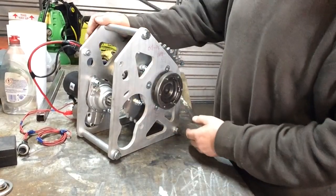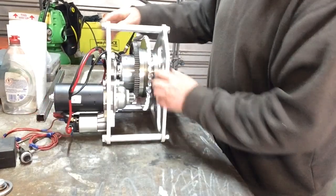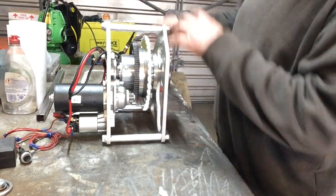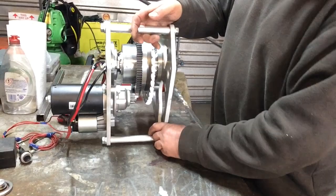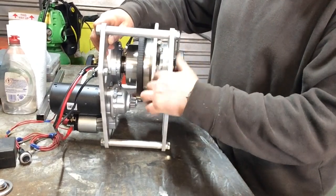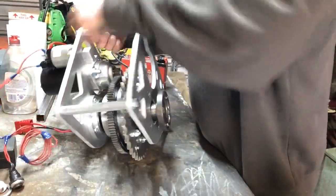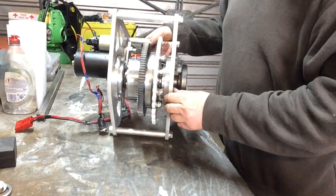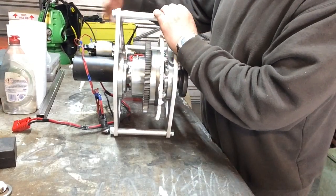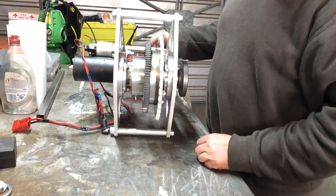This one has what I describe as a pivot type carrier. It holds the differential in sets of bearings. Imagine you've got your sprocket here — it can be mounted in various orientations. This way it will be mounted with the reverse motor at the front, if the sprocket was on the left hand side. It can also be flipped right over that way and have the reverse motor at the back. The reverse motor always has to be hanging out the right hand side due to the direction of rotation of the motor, so that you reverse backwards rather than reverse forwards.